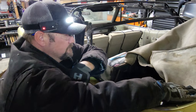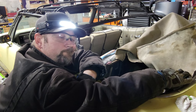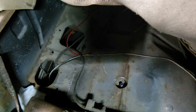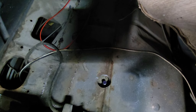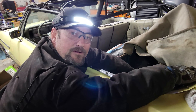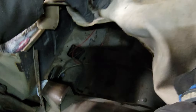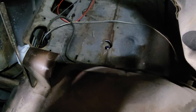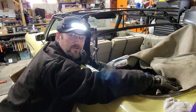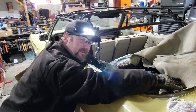Unfortunately we lost two days worth of recording working on this Buick, so Jason's going to explain everything we did. We removed the shocks and struts. We drilled the guide hole from the bottom up through the body, and then we took an inch-and-a-half hole saw and cut an access hole from the top of the trunk so that we can get our nuts and bolts in there. After we're all said and done, we'll install a body plug to cover those up and give you good access for maintenance on those later.